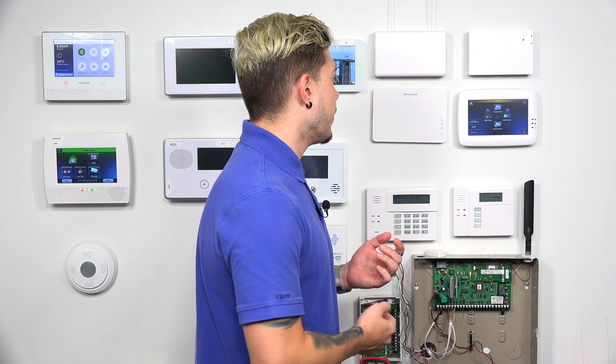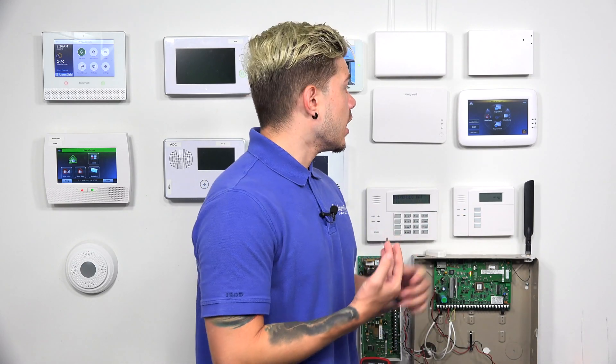It's going to go ahead and start its reset process. It's going to power down once complete, and then power back up. After that, you can go in and rename any of your Z-Wave devices, recreate any scenes or rules you had, reconnect to your Wi-Fi, and adjust any other settings. If you're going to be learning new Z-Wave devices, make sure you get rid of any Z-Wave devices you're not using by doing the Z-Wave reset, then do the exclusion and inclusion just as you normally would.